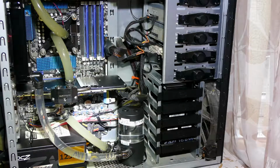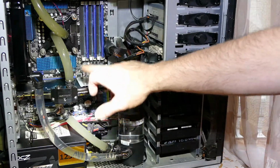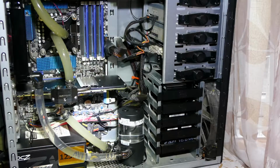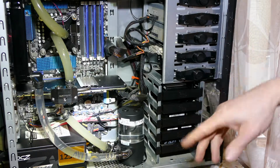You can use a quarter, 3/8. You can go higher to 3/4 if you want as well, purely for volume. Now I have one pump cooling 2 objects with 360mm of radiator. The recommended sizes here is, well, obviously the pump needs to do the head. The head of the pump is the height that it pumps, but we'll get back to that in a second.